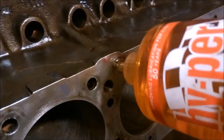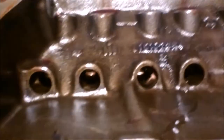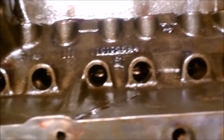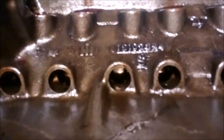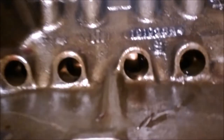There's some play — you still have to make sure they're lined up. These passages feed the heads; the rest carry coolant. You might find that the cam lobes end up offset to one side — that's good, that's how it's supposed to be, so the lifter rotates and wears evenly. If you have one that happens to sit in the center, you can grind a slight chamfer on one edge so it contacts more to one side, causing it to rotate and last longer.